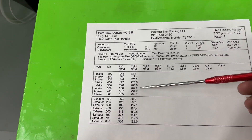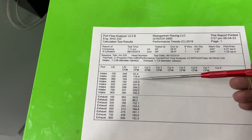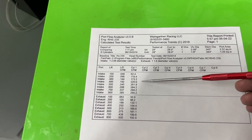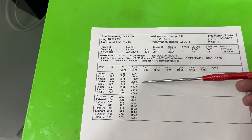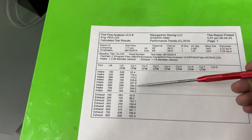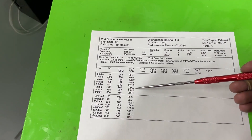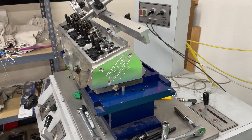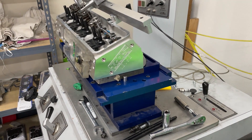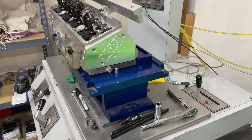So the numbers I care most about are 400, 600, and peak. At 400 lift: 221 CFM — that's pretty low. But if you fully ported this head, redid the valve job and everything else, typically you'll end up around 233 to 240 CFM; they don't break 240. So it's about 20 CFM down if you ported it yourself. At 600 lift: 284 CFM, which is not great, especially for the size. Peak: 294 CFM. From porting this head several times, I can tell you that you can get these to flow easily in the 330 CFM range on my bench — might be like 340 on other benches. If you really put some effort, I think I could get 340 out of them, but I'd probably have to weld up the pinch.